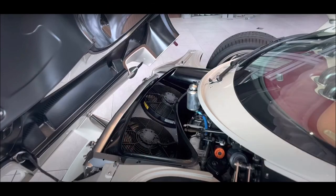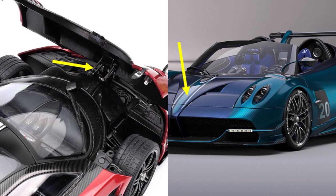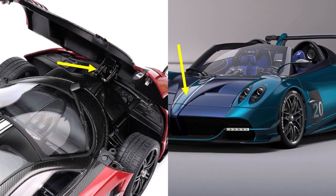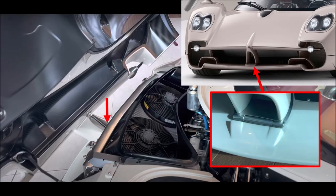The tight front package doesn't really allow for any luggage space, so it's a good thing to have space at the back. Interesting is that the front hood is held by a simple single hinge that is integrated into the front design. Previous Paganis had a nose design because the large center hinge, which sat higher, was covered underneath. The Utopia has the hinge further down and doesn't need the nose design anymore.